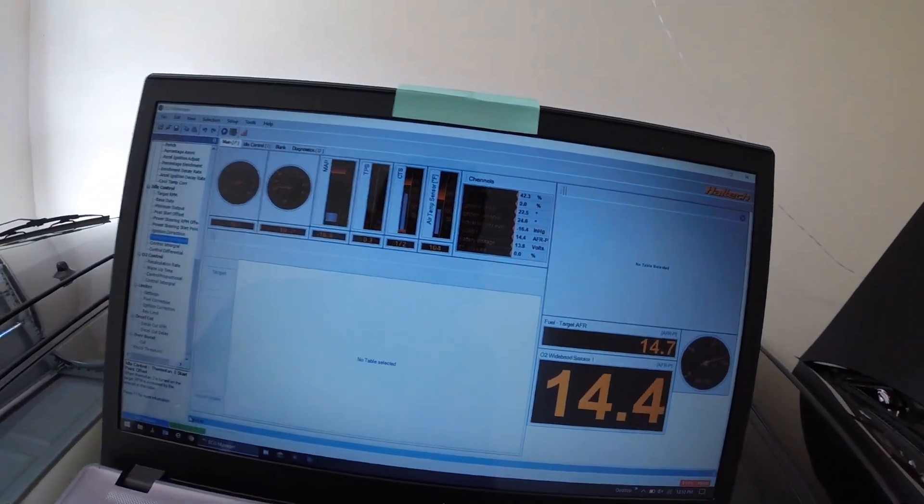It's chilling at 172, which is great. If I remember right, our Nismo thermostat is a 170-degree thermostat. So that means we're basically maintaining thermostat temperature — that is freaking perfect, that is exactly where we want to be. However, I don't want to be so close that the thermostat wants to open and close, open and close. It'll come in time.